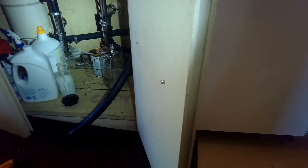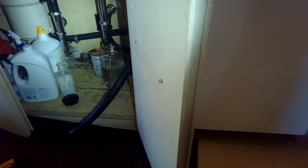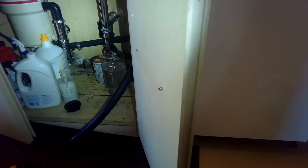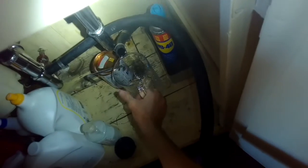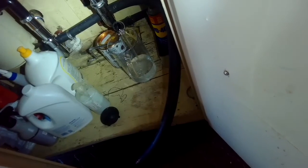So now with the new motor in there, it's moving the water a little bit faster. Not a big difference. I'd say about maybe 20% faster. And that's really what it needed in this case, was a new drain motor. A little bit unusual for Bosch. Usually they last a long time, but this one seemed like it maybe wore out a bit prematurely. So we've solved it. Now we're just going to put it all back together. I'm just doing a little more testing. Remember, if you want it to drain, you just press in on that start button for 3 seconds. There we go. All right, that's good.